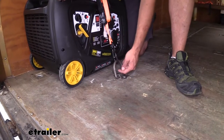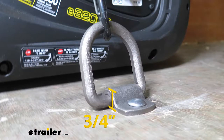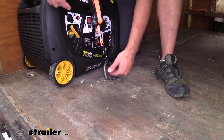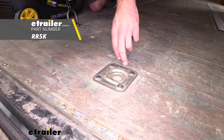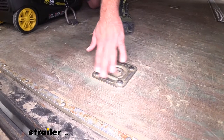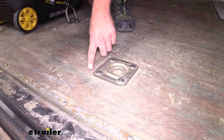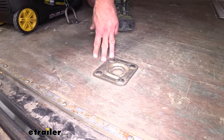This one's going to stick up off the floor of your trailer by about three-quarters of an inch. If you don't like the idea of that, or if you don't like the fact that maybe you'll trip on it as you're getting in and out, we do have some just like this one — this one happens to be from Brophy. You can see your connection point is not going to be as large and as open, but it does sit much more flush and lower to the surface of the floor. In that case, to the top of our bolt here, it's only going to be about three-eighths of an inch.